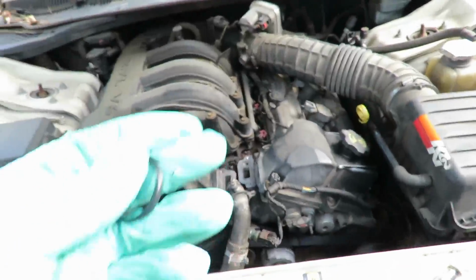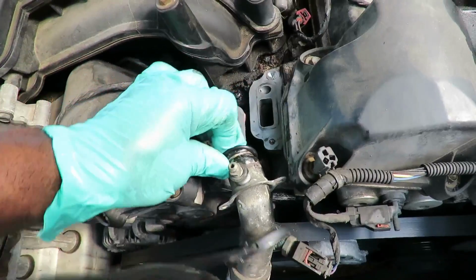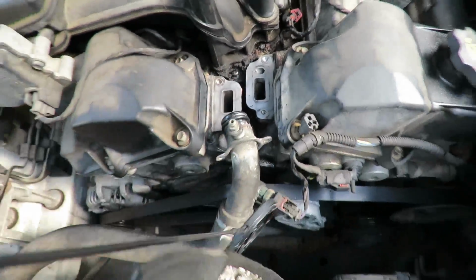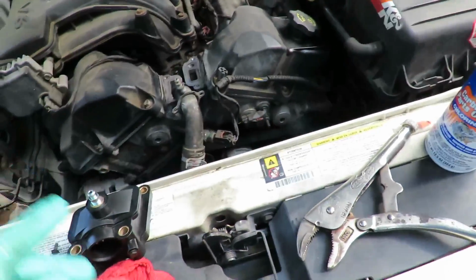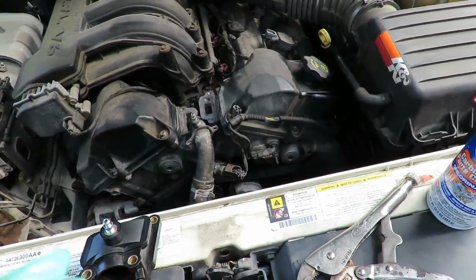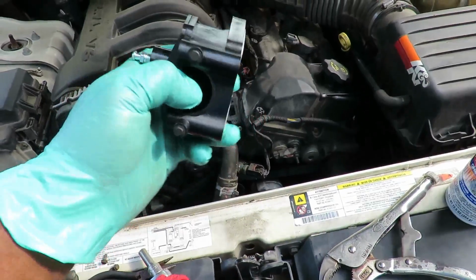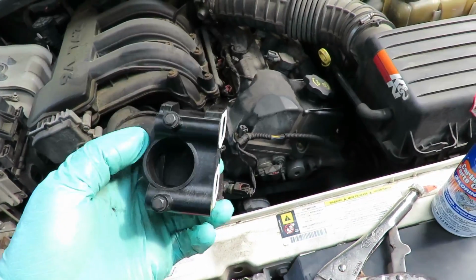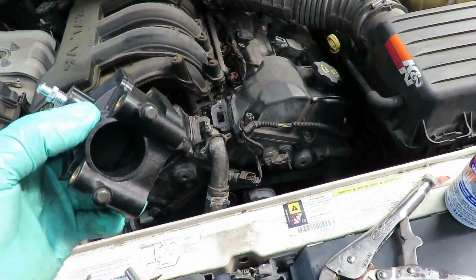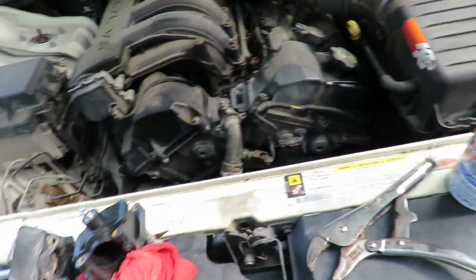The first thing we're going to do is take our new O-ring and put it on that pipe, just like that. And now, which I should have gotten when I was there, what you're going to get now is a little white lithium grease, and you want to put it inside the housing right around so the O-ring doesn't get tangled up, squeeze together, pinch, and cause a leak. So we're going to put a little white lithium grease inside there.